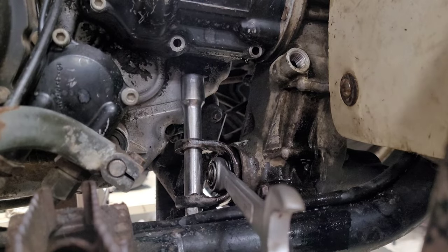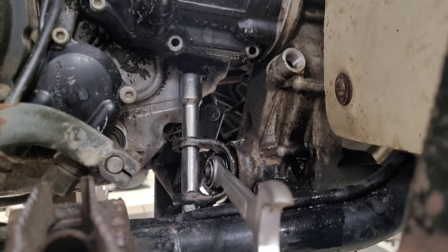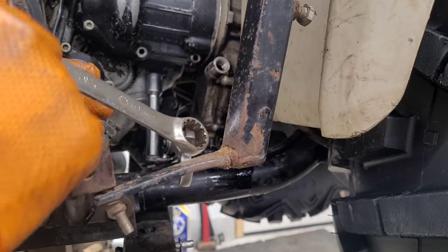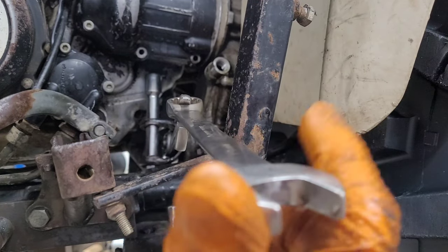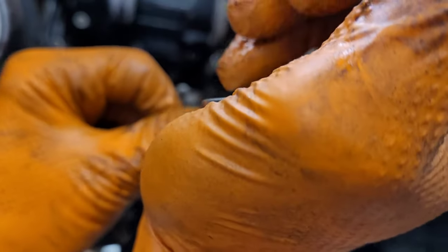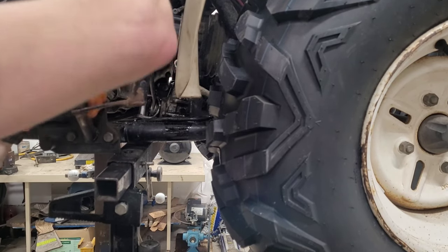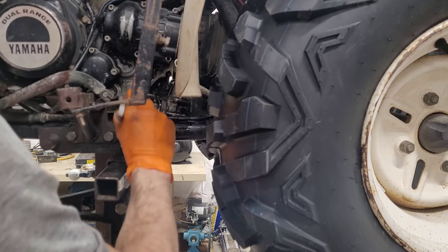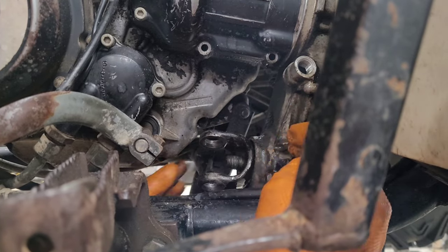Plan B: I've got an extension going through the yoke to hold it — it is leaning up against the crankcase; I'm going to try and avoid cracking that. I'm also going to double-wrench this. I know, I don't recommend doing any of this, but I just can't seem to get it loose. I've put some penetrating oil on and heated it up once more. Let me get the camera slightly out of the way here... Oh hey, it worked! Once it was cracked free, she's good — things are looking up.